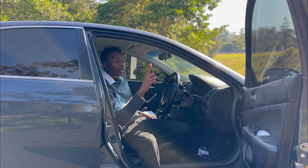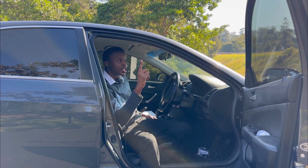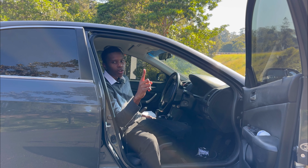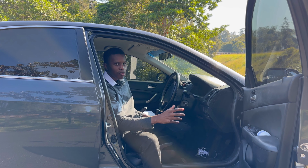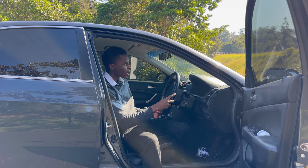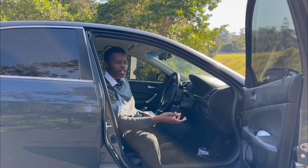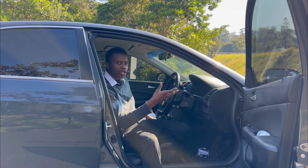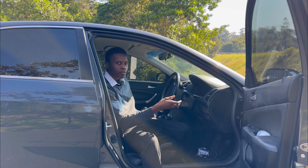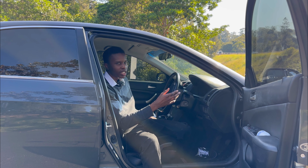But I'll give you the number one tip. The number one main point for this car is the Euro R gearbox and LSD. The Euro R gearbox and the LSD are what transformed this car. This one essentially has a 4.7 final drive, whereas the original gearbox in the manual CL9, I believe, is about 4.3 if I'm not mistaken.